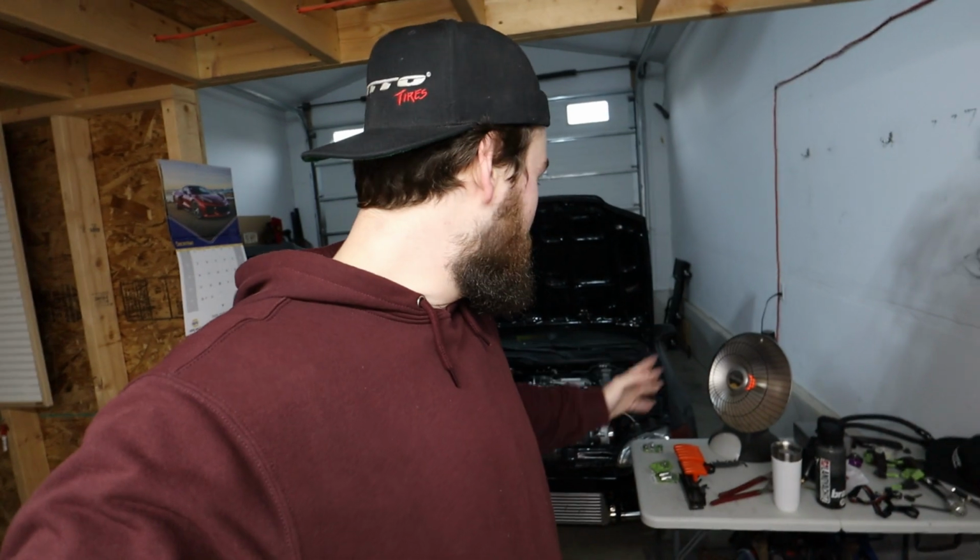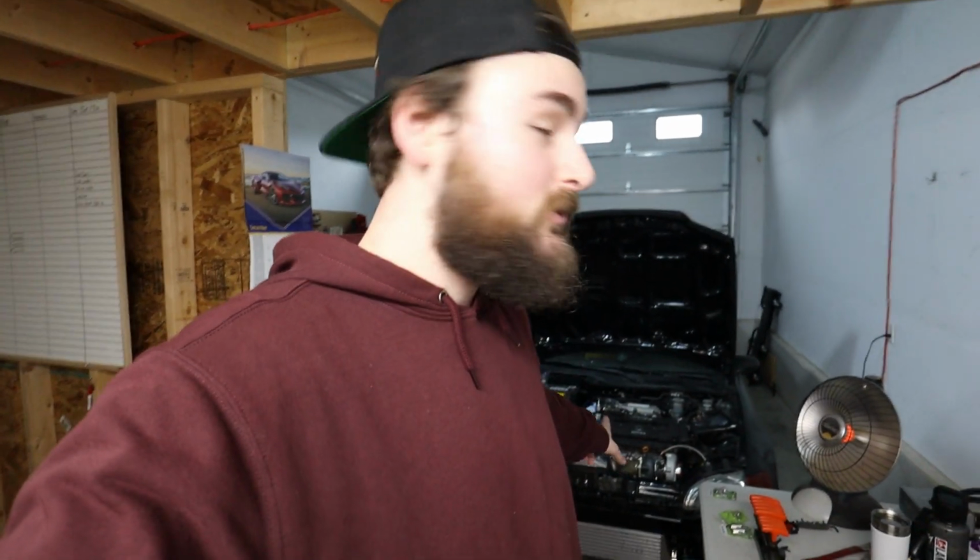When it does, it gets meticulously inspected every time we take it out because it's just at that level now where things can go wrong and we don't want that to happen while we're out on the open road. So every time it gets inspected, I'm on top of this turbo, because as we all know, if a turbo blows up, it can take out your engine in many ways. Metal shrapnel running through the intercooler into your intake, metal shrapnel going back through the exhaust into the exhaust side of the head, a million different things. There's oil running through that turbo, picks up the metal shrapnel, goes back into the oil pan, and now it's circulating around your engine. There are multiple ways where blowing up a turbo can hurt your engine.